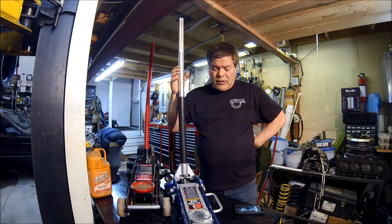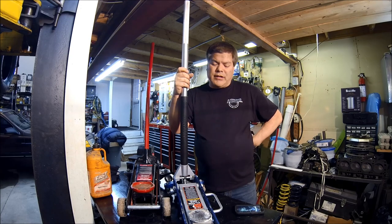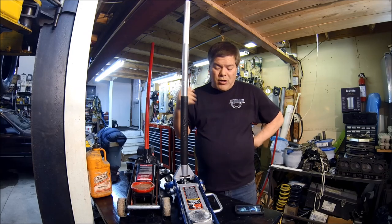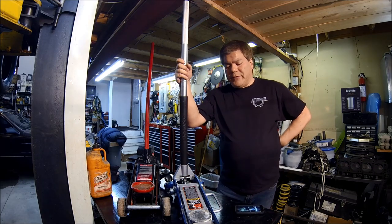These jacks are, again, they're cheap. They're about $150. Good quality racing jacks from the big teams that you see down in the States, down in North Carolina, Brunzel makes a couple of them. There's some ones out in the market. They're $900 to $1,500. But the principle is the same. They all run off a hydraulic piston, lifting up your main arm to get your lift.